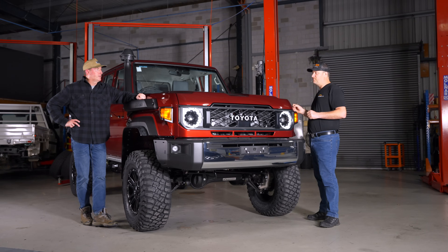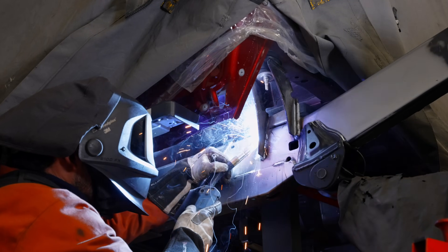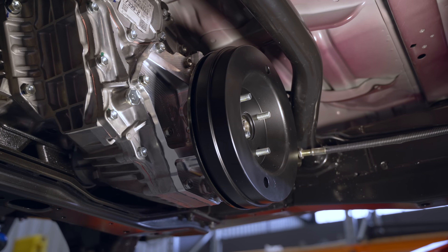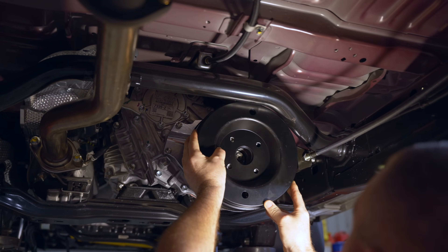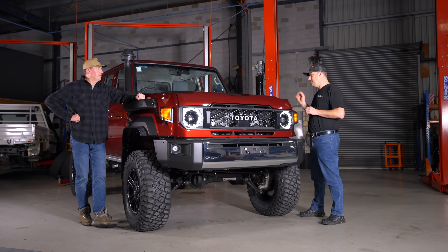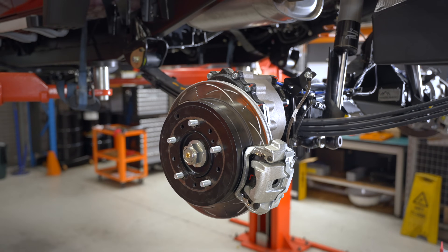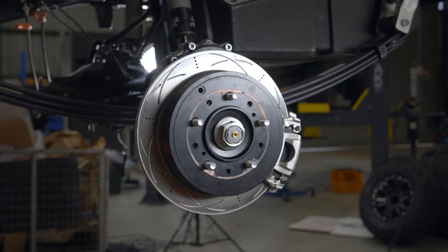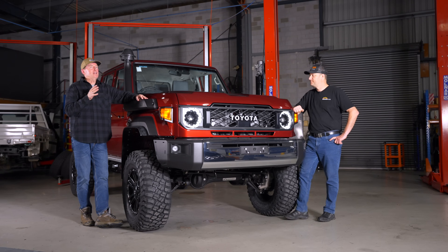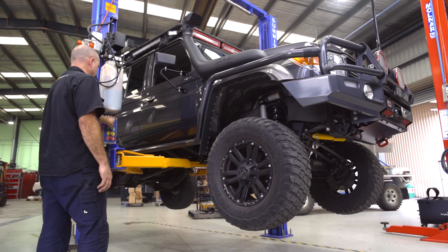You've chosen to have the chassis extension option this time. Yeah, 100%. I took it down to Multi-Drive and I'll admit I was really nervous about that, but the team down there are true professionals — they did a fantastic job. We've got the transfer case handbrake on this one — we've got two options. We've given you the transmission handbrake — it's a fantastic solution for the tradie or someone like that. It locks all four wheels — it gives you the confidence to use a handbrake on a steep hill. We've always tried to achieve the best brakes we can, and we've changed the rotors to a slightly bigger diameter. We're still running the same Bendix brake pads — they're fantastic and they work really well on these cars. One of the things you've solved for future portal owners is the service intervals — tell us about that.